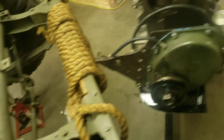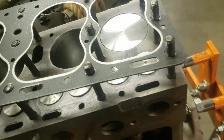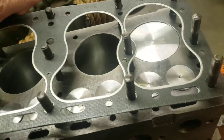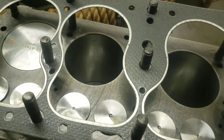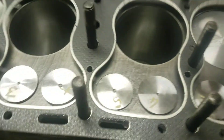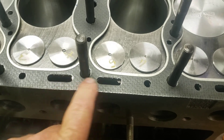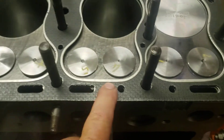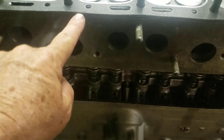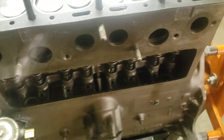We'll get this baby on there. It's always a good idea to double-check your gasket and make sure it fits okay. This side of the gasket doesn't get the copper coat — the idea is this side bonds to the cylinder head, and your slight thermal movement occurs on the metal face, because there is some of that that happens.